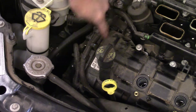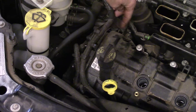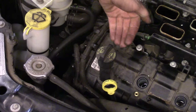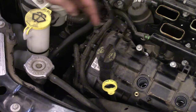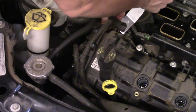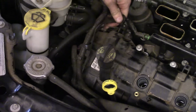You've got a harness here that kind of drapes over the top of the valve cover. We've got to release it — it's attached in multiple places. We don't need anything attached to the valve cover if the valve cover is coming off. So we'll go ahead and start pulling on the Christmas tree fasteners using the same Rubo tools we were using earlier, and try to get them released.